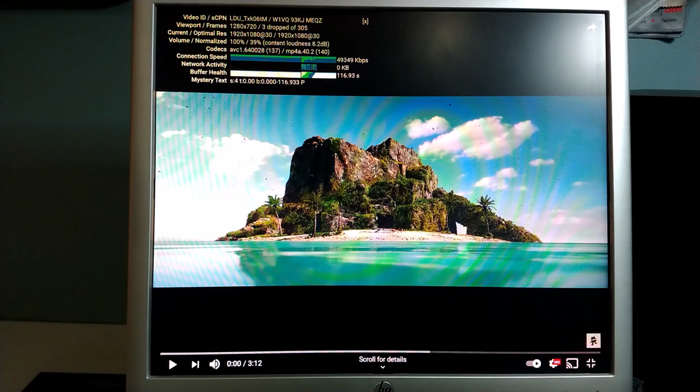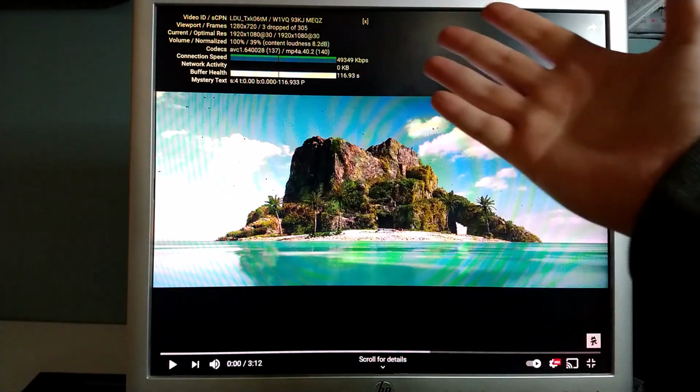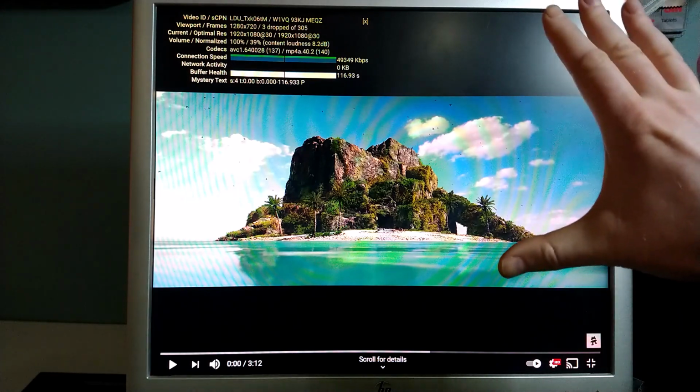Now we'll take a look at Google Chrome running our crab rave test. I do have h264ify, that's h264ify, which is a Chrome extension that I learned about not too long ago from a viewer here. It allows you to change the compression that is going on YouTube videos. Limits you to 1080p videos only, but it is much better in terms of the performance requirements on older computers like this. So we're at 1080p, even though we're on a 720p viewing window with the bars on this 1280x1024 screen.